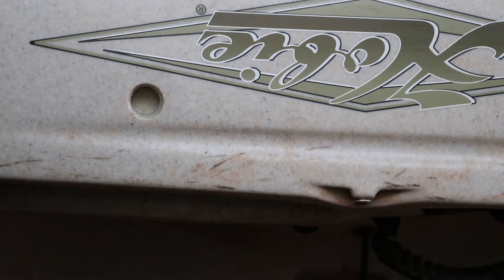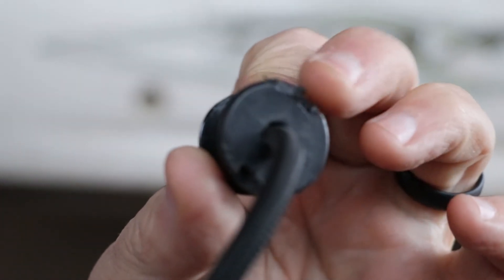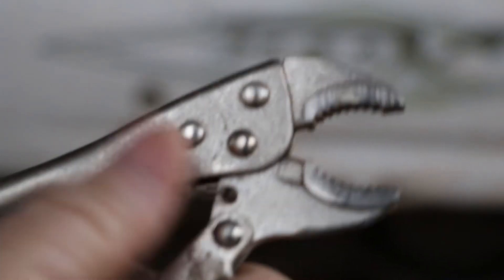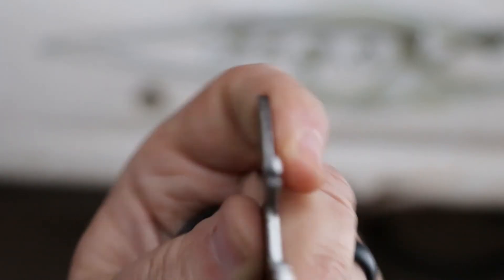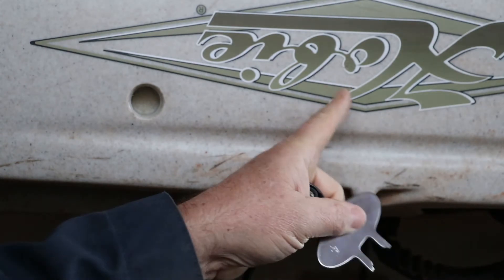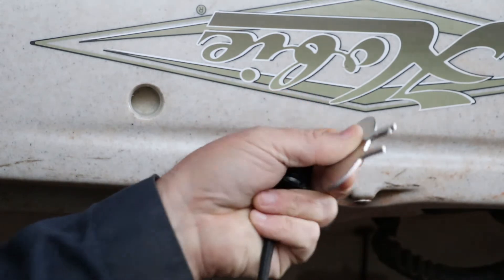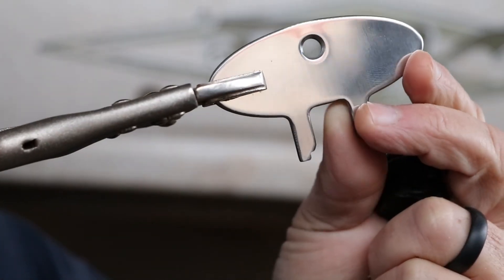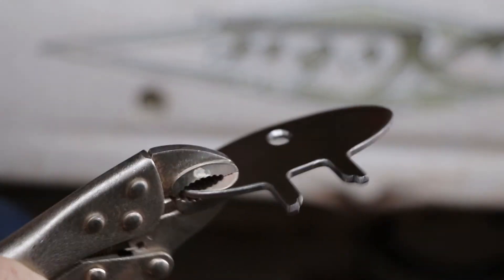Full disclosure: if you look at this one right here, you can see that I did scuff it up a little bit. This one was extremely tight and the tool kept slipping. So I resorted back to the first no-no I mentioned — using vice grips. But don't use vice grips on the plug; use them on the tool. This thing is a little awkward if you're not in a good position. I had it on an overhead rack and couldn't put a lot of weight into it for leverage, so I clamped the tool in the vice grips, gave me the leverage, pressed down and turned with my other hand, and it came right out. I did scuff it up a little bit, but mainly because of the poor position.